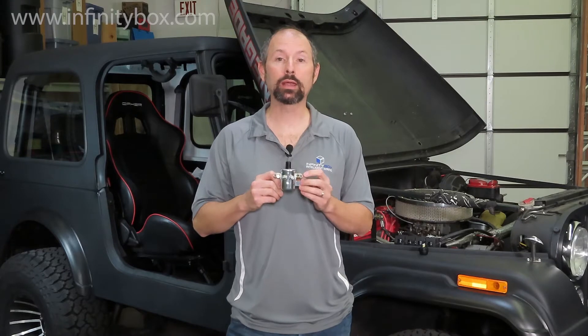In this video we want to talk about the best location for your in-reserve solenoid. In our 1979 CJ7 we're installing our 20 circuit kit and we're adding our in-reserve battery management accessory to the Jeep. In-reserve actively disconnects all the power from the battery in case your battery gets too low, and we'll link a video above that gives you more detail.